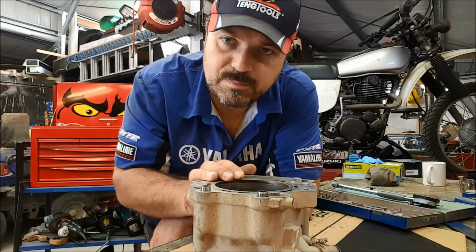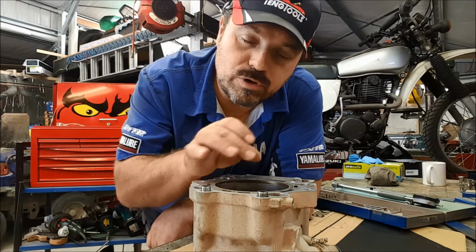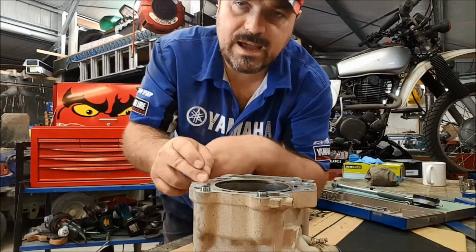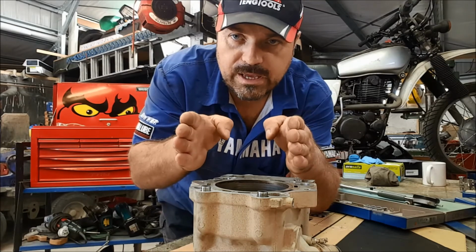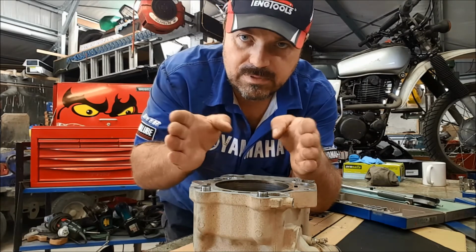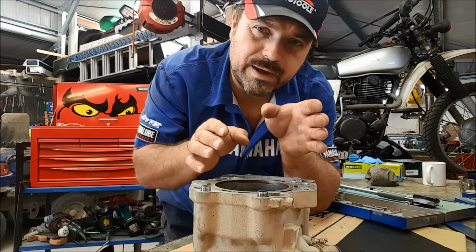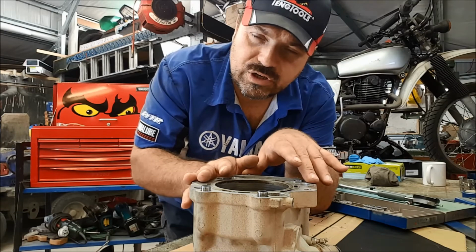The only thing that I have picked up on with the tool is that running across the forwards to back on the cylinder, that's this way, the cylinder has very, very slightly been pulled in due to heat distortion. I would expect, therefore, the measurement on the other axis to have been slightly greater. It wasn't, it was bang on actually. But there is some slight heat distortion.